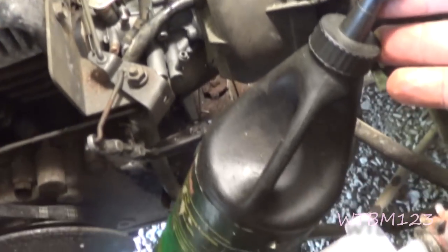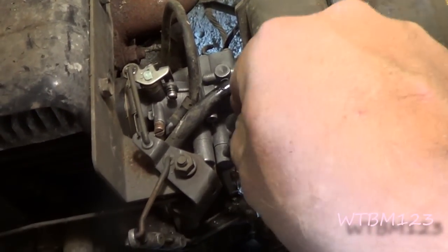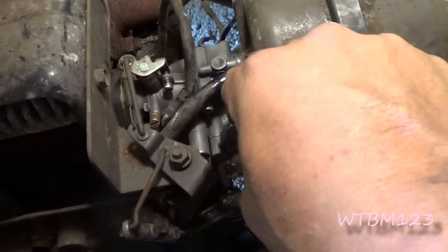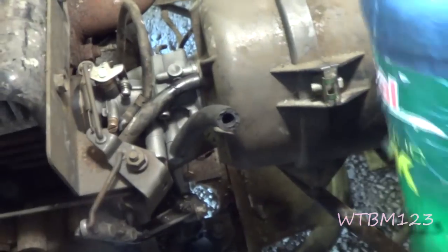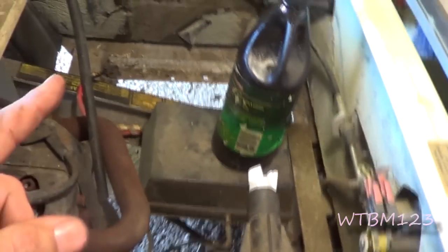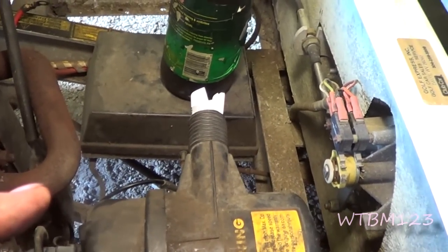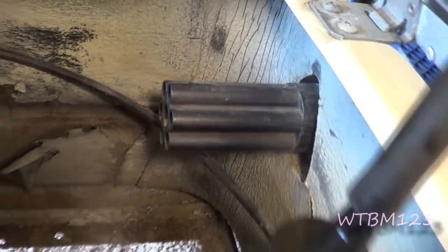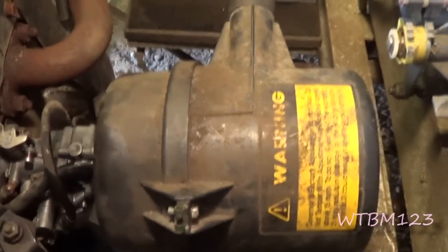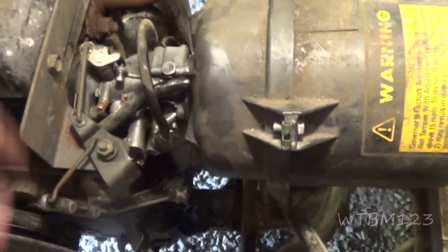What I've done is just got a little squirt bottle here — a gear oil bottle. I just like to put this right over the vent and fill the carburetor full. This is going to take two hands. Now I think we're down to putting the battery in this thing and putting the air cleaner back on, because that piece over there has a plunger in the front that's a choke. So I want to put that back together and a battery in here, and then we'll try this.